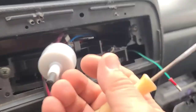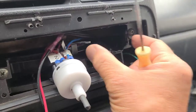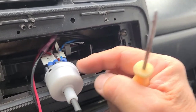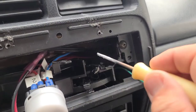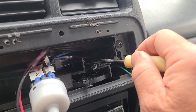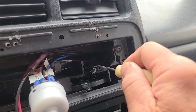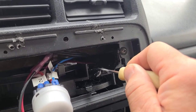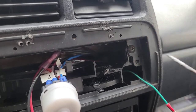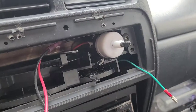So I've attached the switch here, and it goes right here behind the bezel. But there were some fitment problems getting this large round piece in. So I took this hot screwdriver — poker, hook, whatever — I heated it up with my torch, and then I just burned in some relief for it so that now it fits in there beautifully.